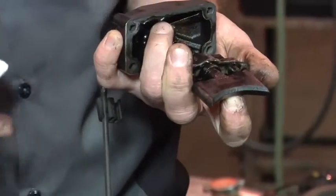Wow, that's clean. It's very clean — this is actually a real good example. So if you have a clean valve, that means you're going to have a good day on the trails. This valve will operate freely. This one didn't really need to be cleaned. Can we take a look at the valve off of this machine? Yeah, we sure can.